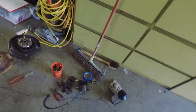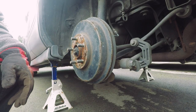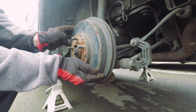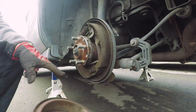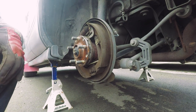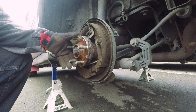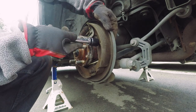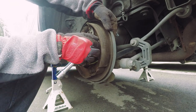Let's get started. Once you have the wheel off and the e-brake in the down/off position, you should be able to wiggle the drum off like that. There's the brake shoes and the hub, which we'll be removing and replacing with the new hub and disc brake drum combo.